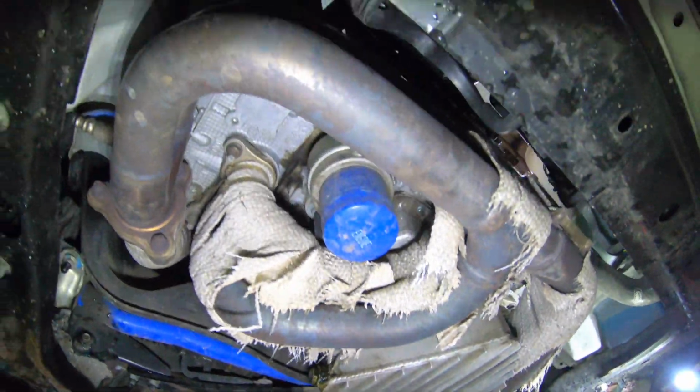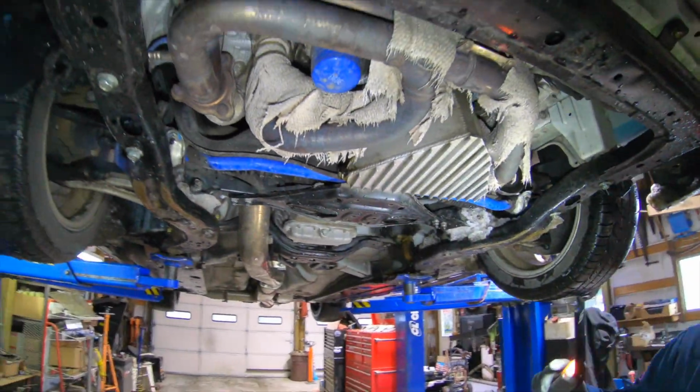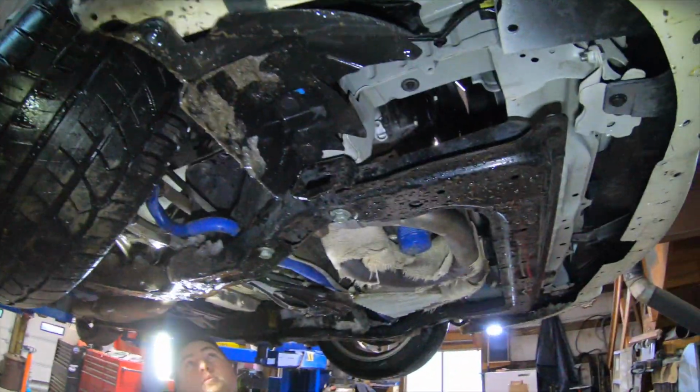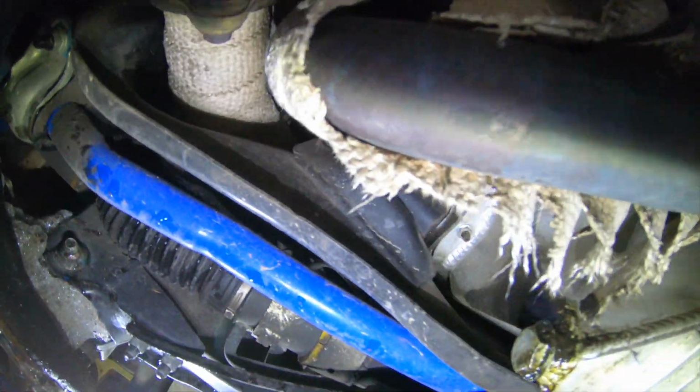Cosworth air pump delete on this car. Big fuel system on it, unknown. Big unknown turbo. It's a Garrett of some sort. It's probably a GT35 or 40. It's pretty big. Internally gated still. Oh yeah, it does say Tomei on the headers up there.